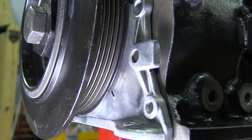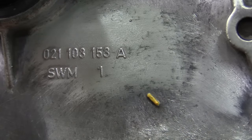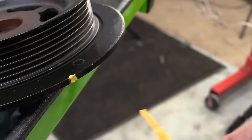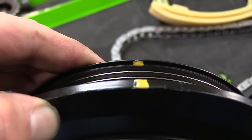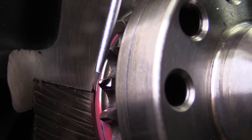On the front side of the engine, there is a mark on the balancer as well as a mark on the crankshaft flange — you can see this tiny mark here on the flange. I like to add a little yellow paint to make it even easier to see; use whatever color you prefer. That mark will line up with a tiny V on the inside of the pulley or the dampener. I also like to put a mark on the outside of the dampener so I can see the position of TDC no matter where I'm looking at the pulley.